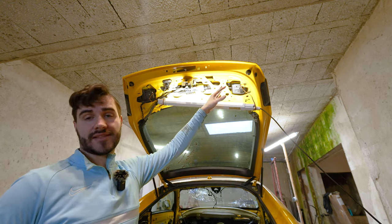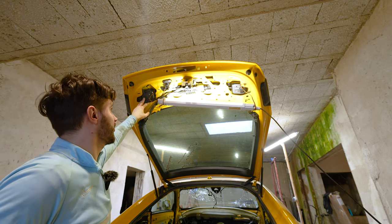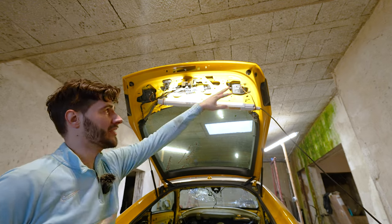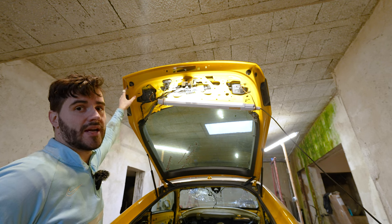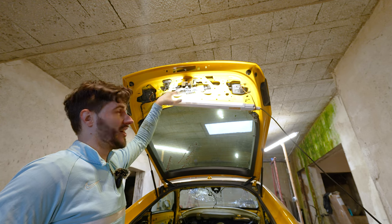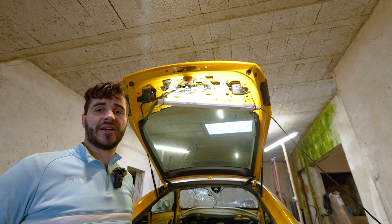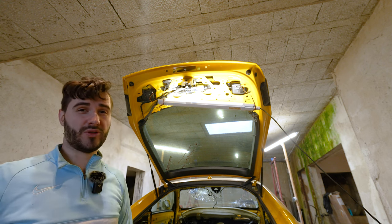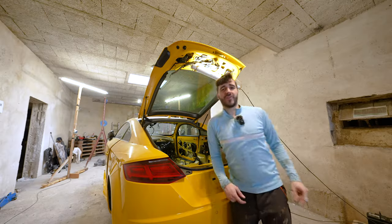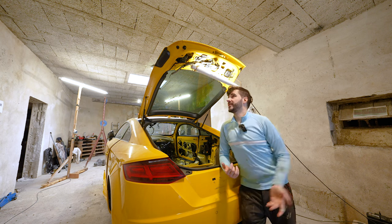Please do note that you need to do this on both sides of the car — they are exactly the same on both sides and routed the same way. So you need to flush with both the compressed air and the brush on this side and that side as well. Make sure your spoiler is up, and that way you can blow the compressed air through the drain hose all the way out.